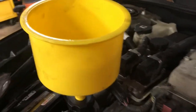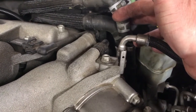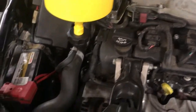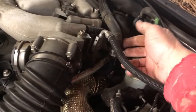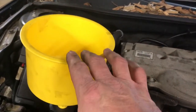Quick little tip here: I'm adding coolant right now with my no-spill funnel, but I actually disconnected this one heater hose so that I can let the air bleed out. We're going to keep filling and hopefully coolant will come up through this pipe and we'll know we're all bled out before we crank it. I went ahead and filled it until I got coolant running out of this tube, then capped it off. We'll crank it up, let it get to operating temperature, and keep checking the fluid level.